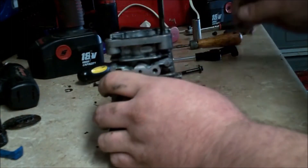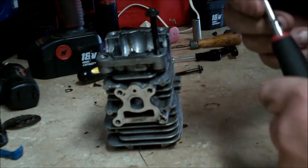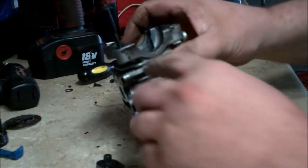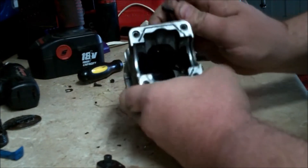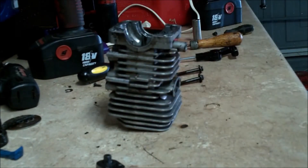This repair is actually stronger than the factory threads just threaded into aluminum. You now have more surface area for the bolt to bite on around it to hold against the aluminum when you tighten it down. If you have any questions about how to helicoil stripped threads, let me know. More Medic One — y'all have a good day.